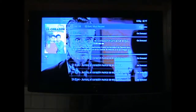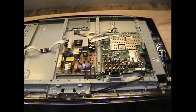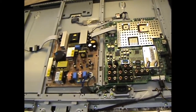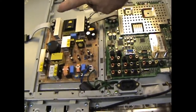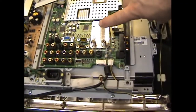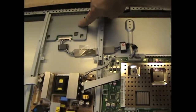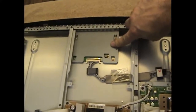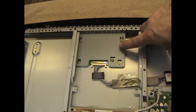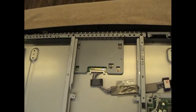I'm going to open up the back of this thing, get it out on the workbench, and show you how to swap out the board. This is the back of the television. This board here is the main power board, this is the main logic board, and underneath this is the t-con board. The t-con board is what connects the logic board to the screen.